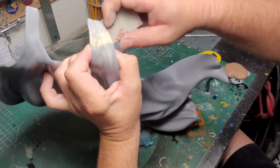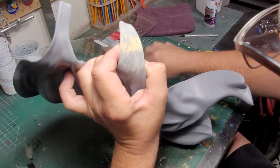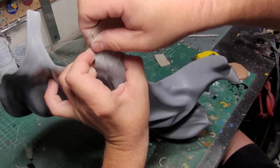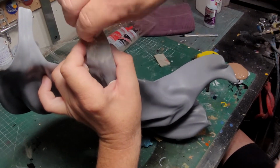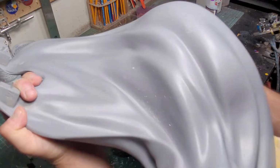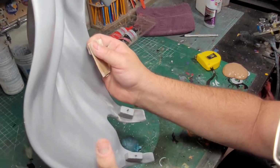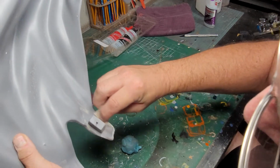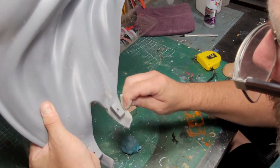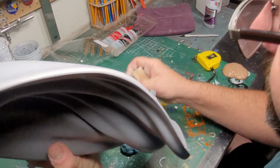And also have a sanding sponge here. I think what I'll do is, instead of going in there with just straight up body fill, I've got some spot putty that I think will fill in that really small crack pretty well. And not even bother sanding. Yeah, I'll sand the bottom side a little bit. Not too much, because I really don't need to. Looks like that piece fit on there pretty good.